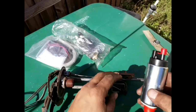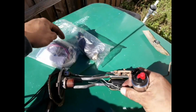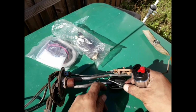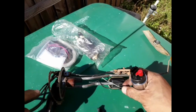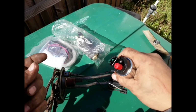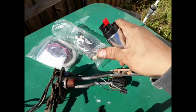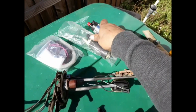Okay, so the harness. Clip these out. Install my new harness to the one that belongs. Gray is going to be positive. Black is going to be negative. Okay, I'll just follow the wires, make sure where my ground is, just kind of follow it all the way and confirm that's ground. And then do a battery test real quick, just to see if it's supposed to work. And voila. So remove, replace, and install back into the fuel tank.